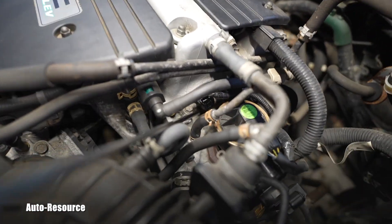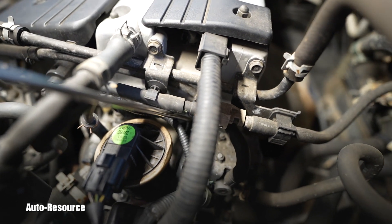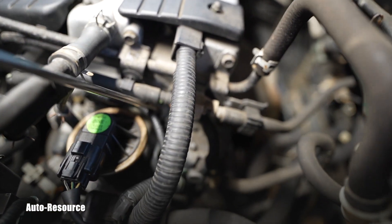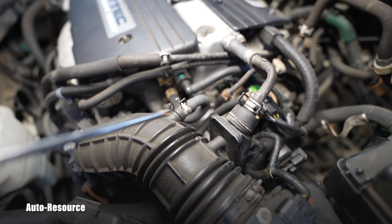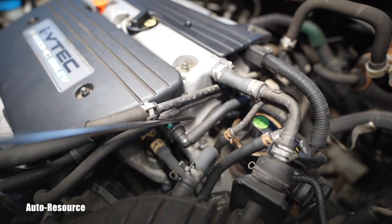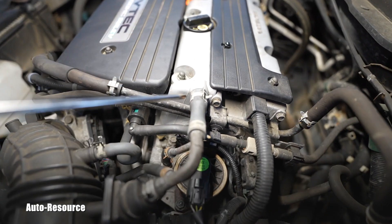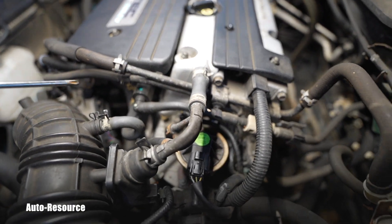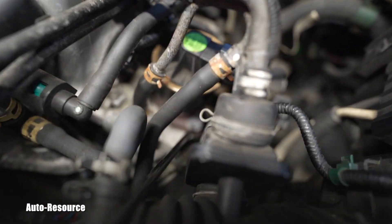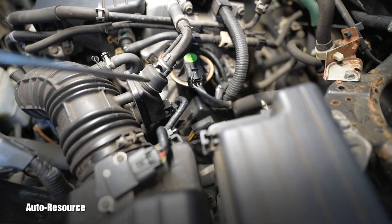That 10mm bolt isn't visible right now but it's right there. The other sensor is right next to it — if you look down there, you can see the electrical connector for the exhaust cam sensor. You can see the exhaust pipes are on the back side, so the cam sensor towards the cabin is the exhaust cam sensor. These are two small plastic electromagnetic pickups that read the rotation of the cams and communicate with the ECM — the computer. To access them easily, you first move the air intake piping to the front, then remove the EGR valve, which is held by two 12mm bolts — one here and one right behind it, accessible with an extension and wobble.